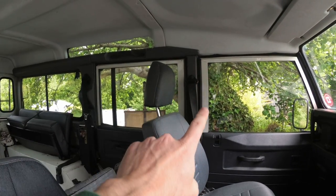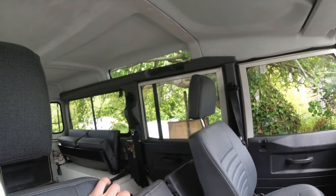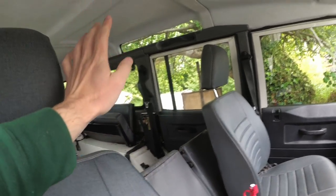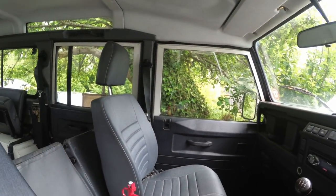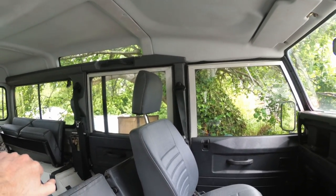The other way is to check the door frames on the inside. There will be a different colour than the outside of the vehicle, because painting the inside of the vehicle — particularly the rear tub and the floor and everything — you've got to take all the trim out and all the doors. So the inside of the doors being a different colour is also evidence of a cheap respray.